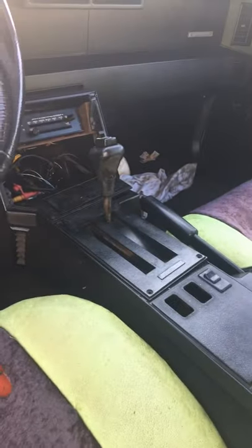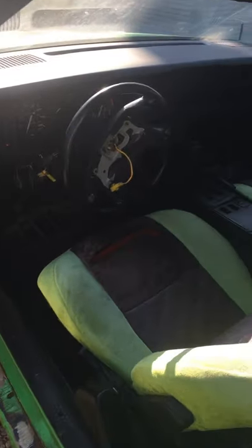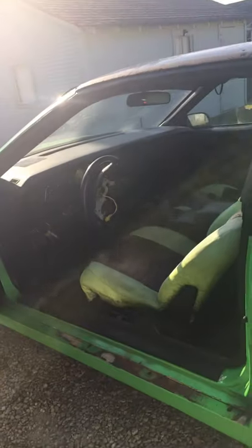It's got 24s — the donka donk. It has the square shifter, which would indicate a 5.7. It also has — if anybody remembers — wait a minute, okay, it has the round gauges. The '90 or '91 had a one-piece gauge cluster. It has all the markings of electric windows but it has crank-ups. Another giveaway for the 5.7 Z28 IROC was the gauges, the hood, and certain emblems — which it does not have — and the dash doesn't appear to have been changed.